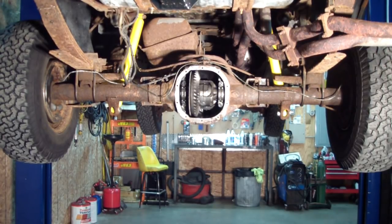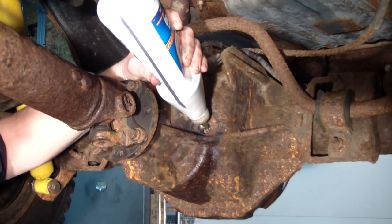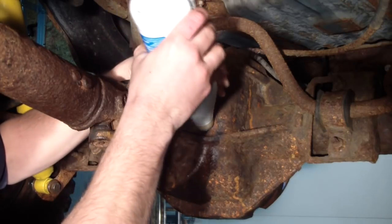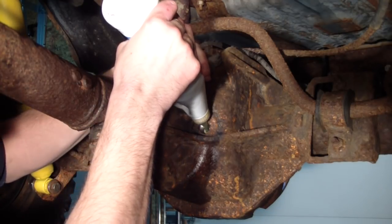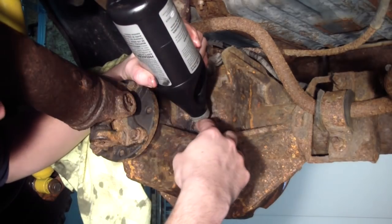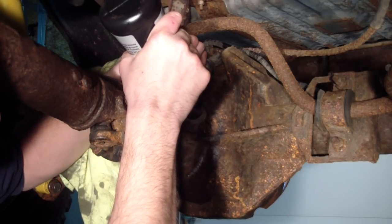I'm going to put the cover on and get some gear lube in it. I wanted to mention — like we did with that gear lube transfer pump video — that the owner looked up the fill level. Apparently if you have conventional gear lube the fill level is up to the plug hole, but if you use synthetic it's five-eighths of an inch beneath the plug hole, according to a 2012 Chilton's. The bottom line is you should do your research before filling your differential. Look at that rust — typical rust belt stuff. I'm going to do a tight figure eight in this truck now and see if we hear any ratcheting.